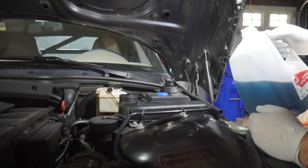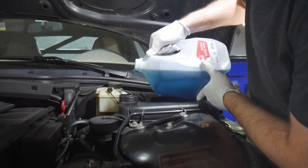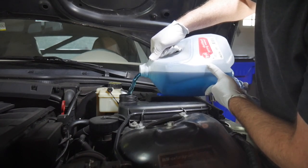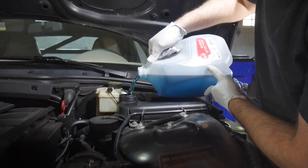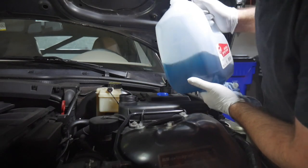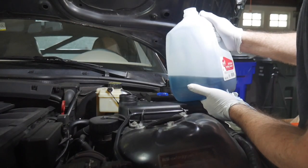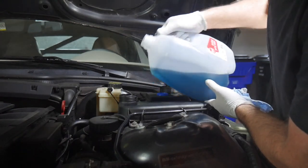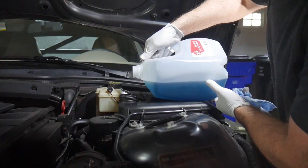Whenever you've drained a coolant system and filled it up again you have to make sure you're not introducing any air pockets. Some BMWs can be tricky to burp, but this M52TU is not one of them. In the past I've gone through elaborate procedures involving fancy funnels and turkey basters, and as it turns out none of that is actually necessary — mainly because the coolant reservoir is the highest component in the coolant system, sitting nice and high tucked in behind the strut tower. No elaborate burping necessary; you can twist open the bleed screw on that reservoir once the engine is up to temp, but I found even that sometimes isn't necessary. One last note: the bobber is difficult to read, so I usually just stop filling just before the bobber peaks above the neck where the cap screws back on.